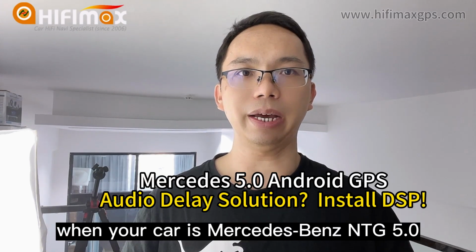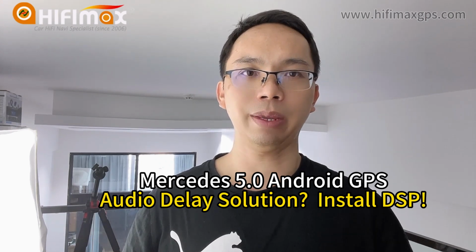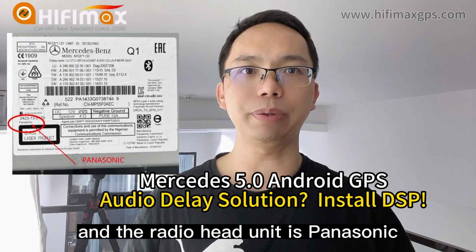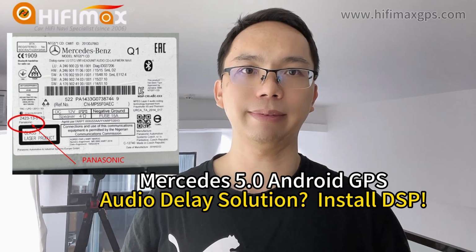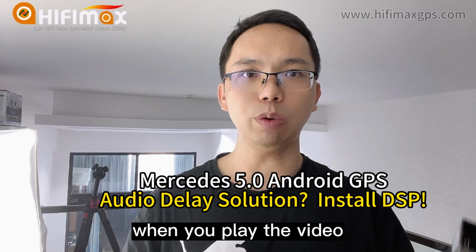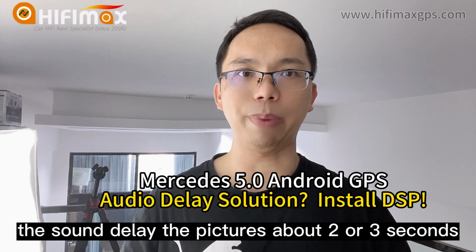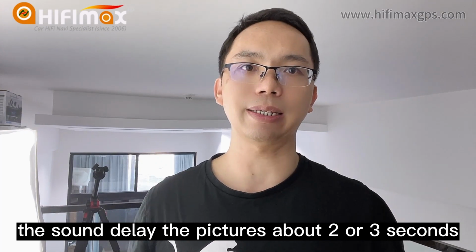When your car is a Mercedes-Benz NTG 5.0 and the radio head unit is Panasonic, in that case, it has a problem. When you play the video, the sound is delayed from the pictures by about 2 or 3 seconds.